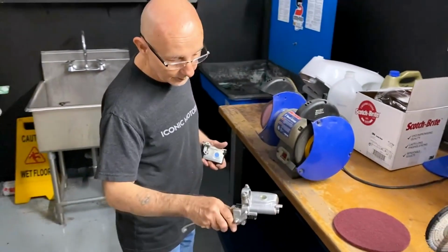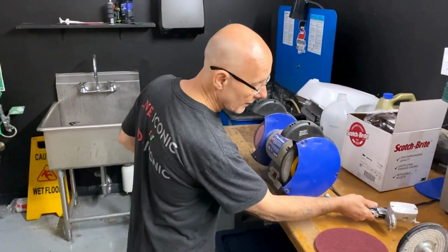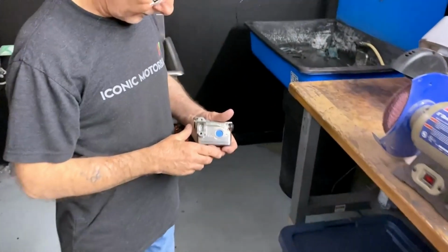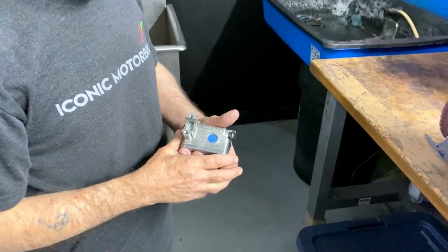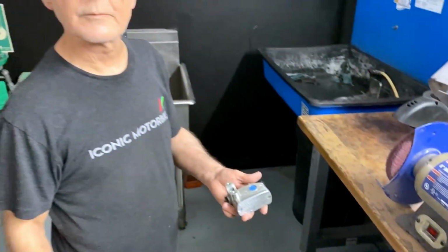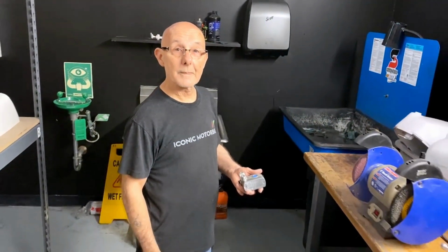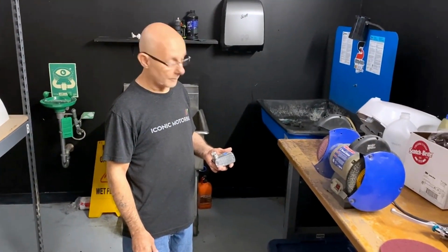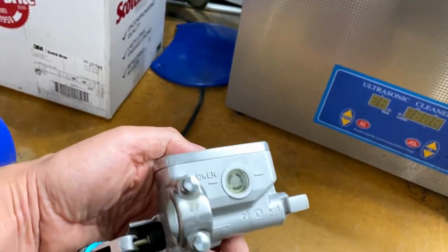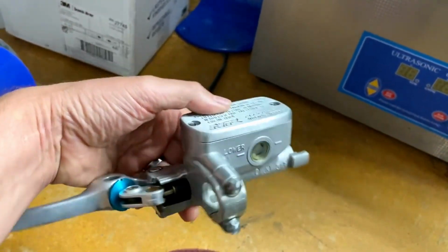What are we using in a bead blaster? Glass. All right, then after that, you usually throw a clear coat on there also, right? Yeah. Then I clean it all up with acetone and clear it with just a rattle can. That keeps the finish nice and clean and keeps it from oxidizing again. It makes it look like this and stay this way for a long time.